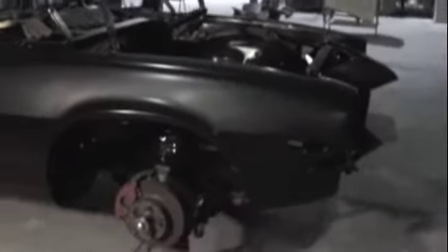Here's our 70 Camaro again. We put the front end back on, I've lined up a few more things. I've went through readjusting the doors, moving forward — both doors needed adjustment. We got a nice even line out of the back. I've started marking things, dollied and filed, and I've got a real nice line here now. This is in its rough end but I've got a real nice three-sixteenths gap. I got some fine things to do with a file — you can see where I've ran a file across it showing me my lows. The driver's side has turned out just gorgeous — a real nice three-sixteenths gap down it.